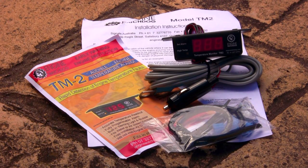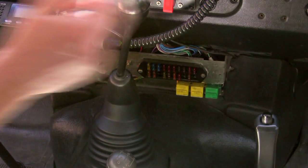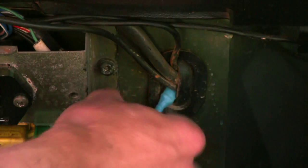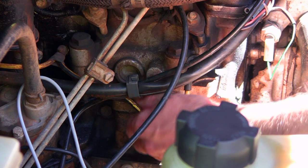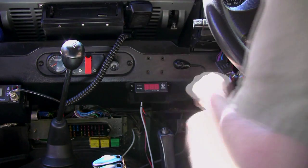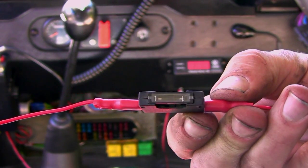So we'll put it in and see how we go. The kit contains everything you'll need for the installation. Start by removing the fuse box cover and then peel back the interior to expose the firewall. Thread the sensor through the grommet and feed the cable to an available bolt. Be sure to retighten any bolts to their specified torque. Mount the unit with double-sided tape or screws. I chose to hardwire the unit and install a one amp inline fuse.